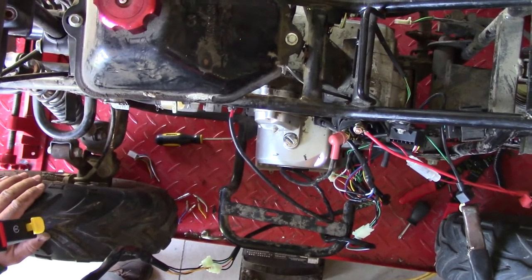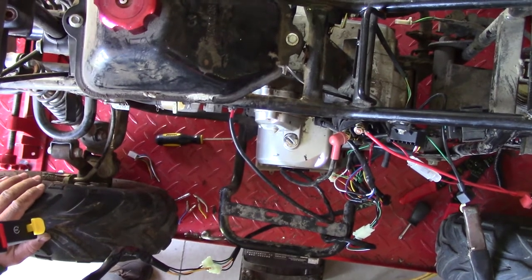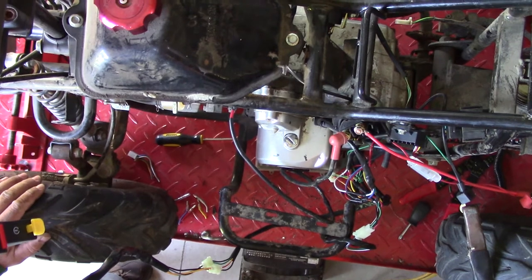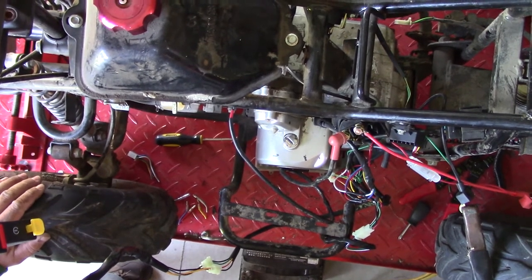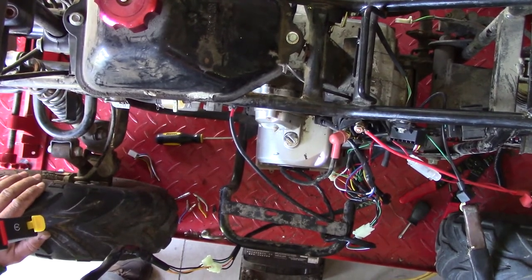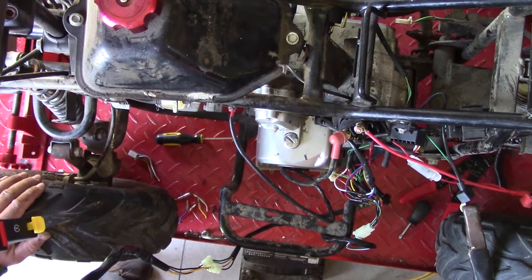Where's the shifter? There isn't a shifter — it's an automatic transmission, it's probably stuck. How do you shift it into neutral? You just don't rev it up. Kind of like the Arctic Cat we have — you put it in gear and accelerate to make it go. The centrifugal clutch is probably just sticky — it'll come loose, or we'll take it apart and make it come loose.